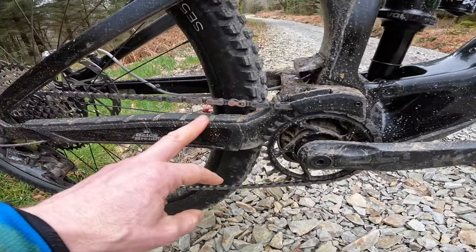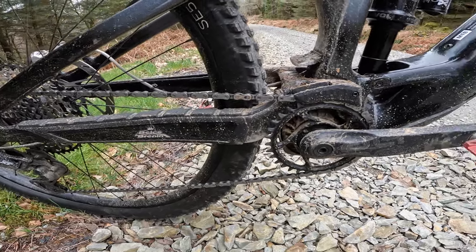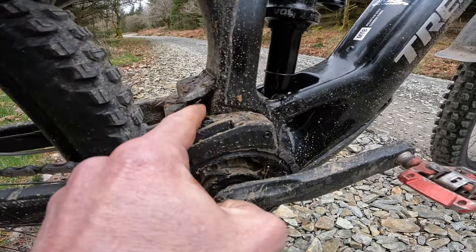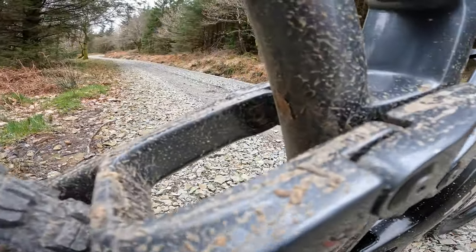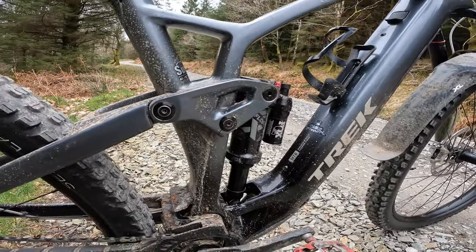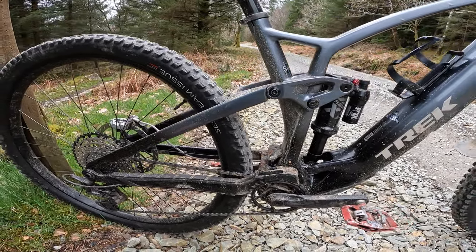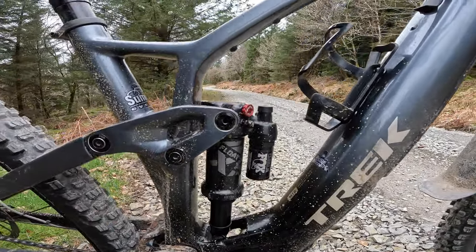See, you've got really nice top and bottom protection there on the chainstay. You've got another little mudguard flange there, protecting that main pivot and the cable and hose entry into the mainframe there. You've got, like I say, that chip in the back there, which not only helps you change the geometry by half a degree, it also means you can set the back up for a mullet rear wheel if you want a bit more playfulness in the back end.